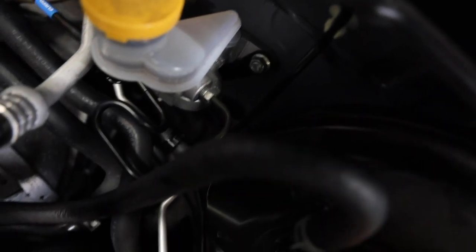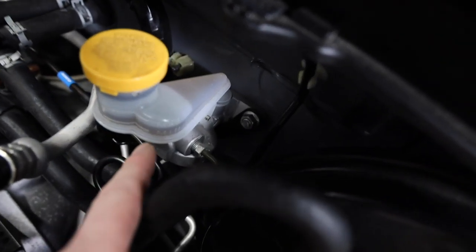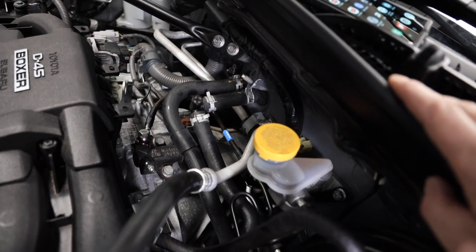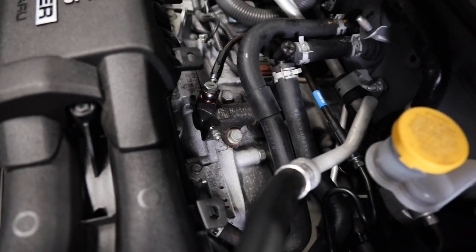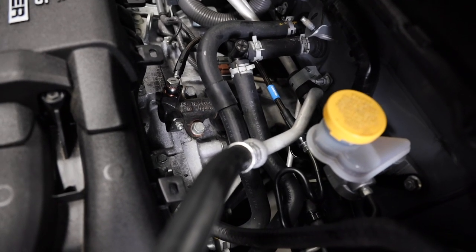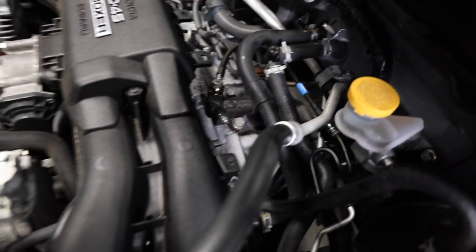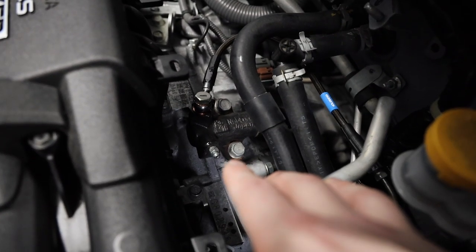Here is the hard line coming off doing some weird zigzag stuff, and then it wraps around to where our new clutch line is with the blue Cusco logo, goes underneath the heater core hoses, and then wraps around to the top of the transmission. Right there is our bleeder valve underneath it. Because my power bleeder doesn't have a cap that'll fit this, I'm going to put a little more fluid in here and have someone help me bleed the clutch. They're going to depress the clutch a few times to build up pressure, while the clutch is depressed I'll open the bleeder valve to let the air and fluid out. We'll do that three or four times. Once the clutch feels good and doesn't stick all the way to the floor, we'll hop in, turn it on, and make sure everything works. I'm going to top off the fluid up to the max line, and the bleeder valve on that is going to be 5/16ths, so make sure you have the proper inch wrench — you don't want to strip that out.